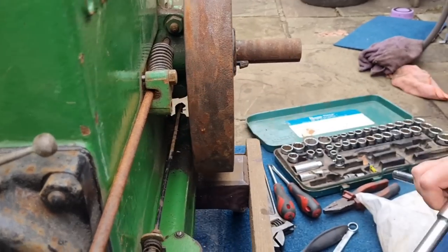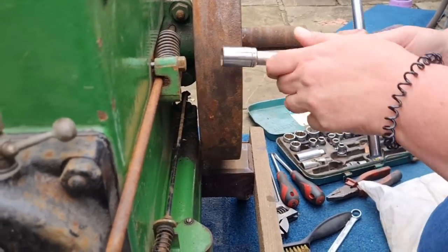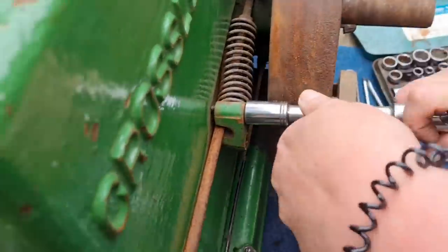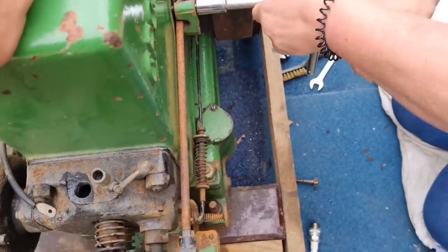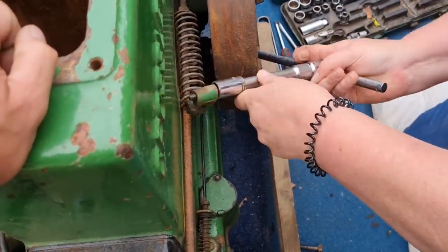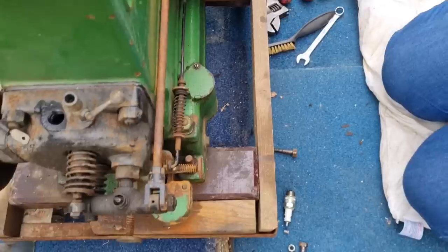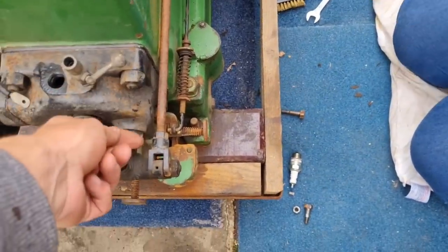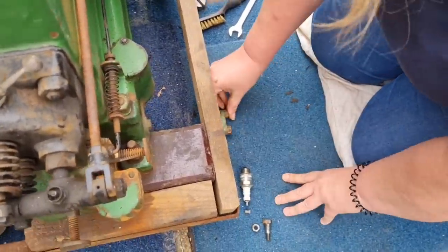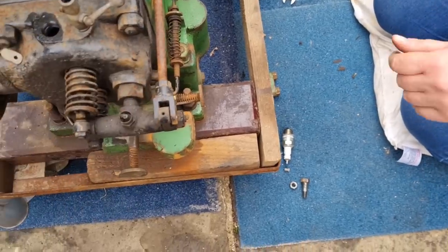Right. Okay. Take that top one right out. Mind, that might spring, because that's on a little bit of spring tension, so that bracket might spring out when you... There you go, that has sprung. Right, now you can pull that push rod out. Put them bolts back in there and set them one side. Now lift this push rod up this end.